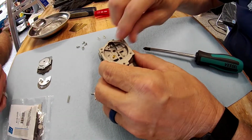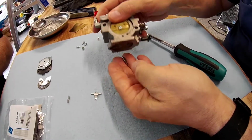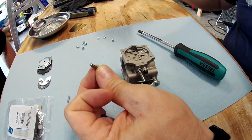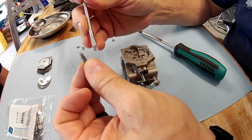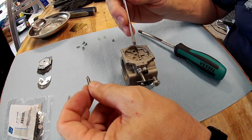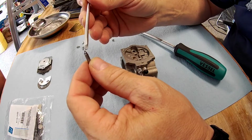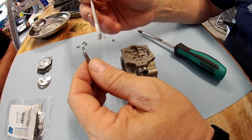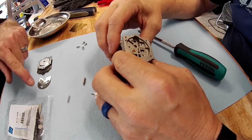But this little guy right here, this is the plunger I was talking about. Now, this one also comes in your kit, but what'll happen is, this is when your fuel pops off, this opens up, and then when it gets down to pressure, this drops back down and closes off your jet between high and low jet. Now, this little area here will wear down, so that's why you want to replace it whenever you rebuild, because this can cause fuel bleed and you won't get the right transitions between your high and low for your mid-range.